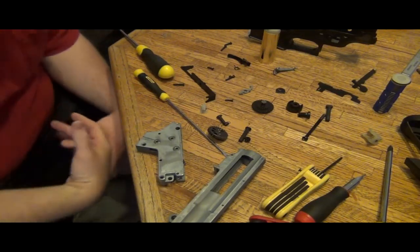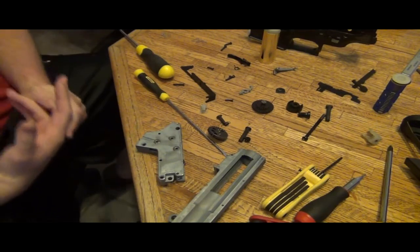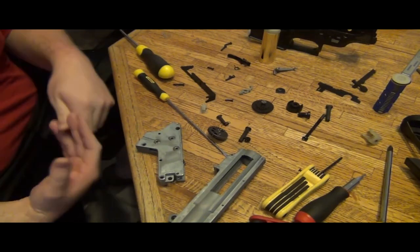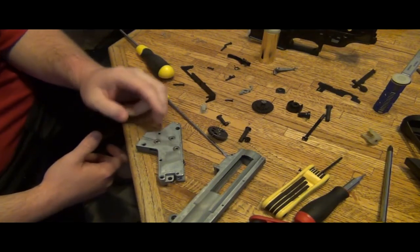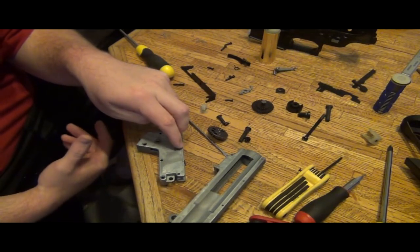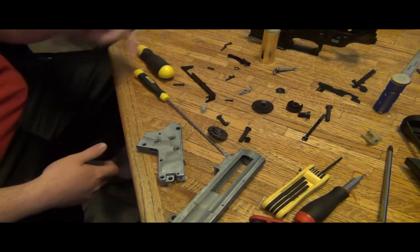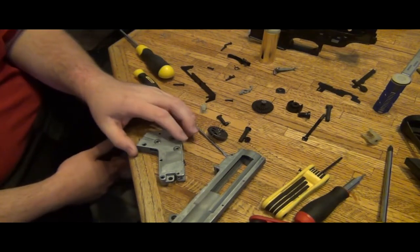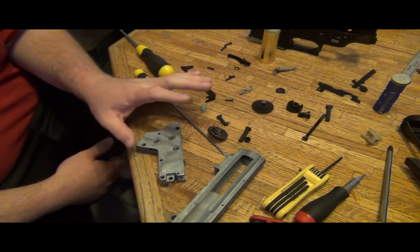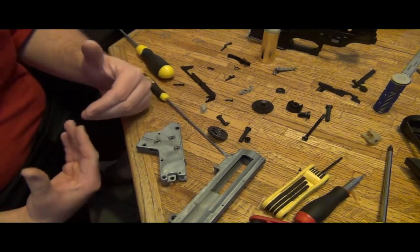All right, I'm going to begin the shimming part of the ICS PCR-97 with the stock ICS bevel gear and then two gears that are SHS 13:1 ratio. I've got 0.1 and 0.2 there. I think this time it's going to be different than any shim video I've done: I'm going to add shims to what's already there.